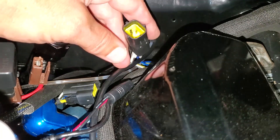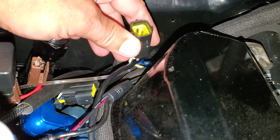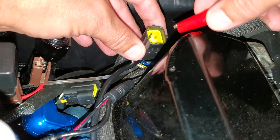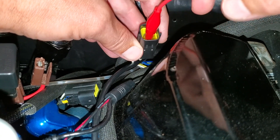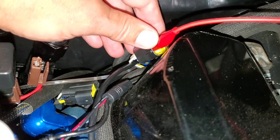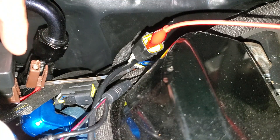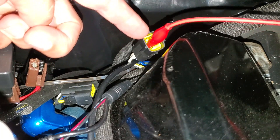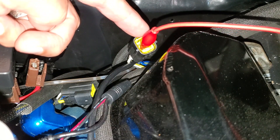I found the four-pin connector and there's our white wire that we are going to test. There are some pins in there, so I'm going to get one of my jumpers and connect to the white wire. Now I can use my volt meter and run it to the cabin because we have to turn the key and watch the volt meter. While we're here, I also took off the power lead that goes to the distributor — right here — so that way we can crank the engine without it firing and watch the behavior, see what kind of power is on the wire.